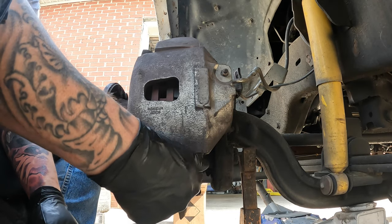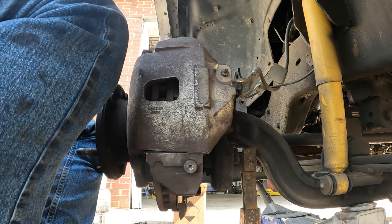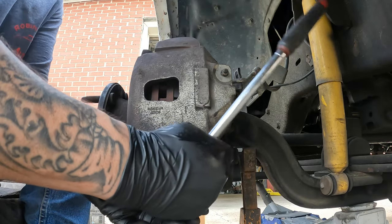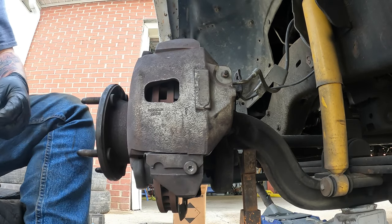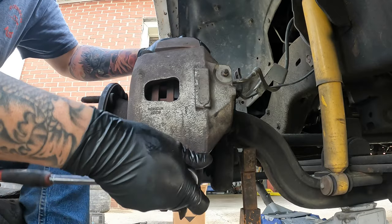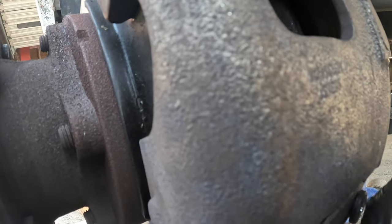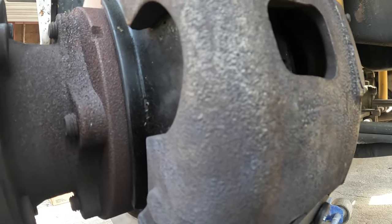Since I know I can get it back out, I'm not going to torque this one down too much — just going to put a little bit on it with my regular ratchet and hammer the pin back in. We got it in there. We're going to replace that set screw when the new one comes in. That bolt normally torques to 15 foot-pounds just so everybody knows.